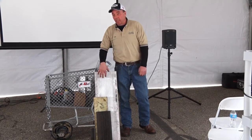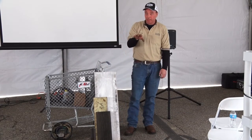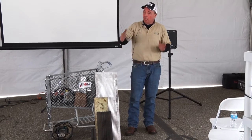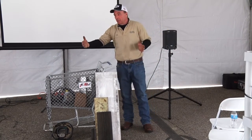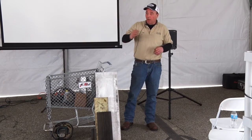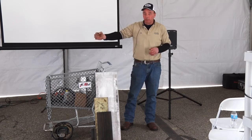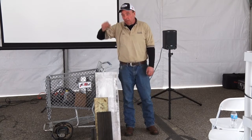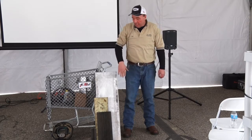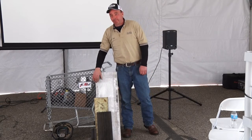What we end up doing is we acid wash the floor, scrub it really good, dry it thoroughly, cut our new aluminum to fit in the trailer, and then in every 4-inch centers all throughout we drill holes in the new aluminum, and you sit there and weld all day each one of those holes. And the reason is you didn't pull your mats out.